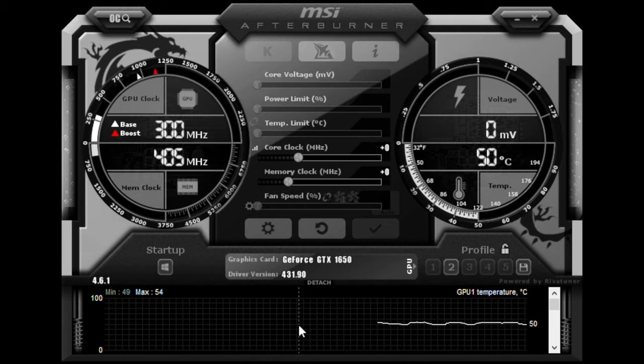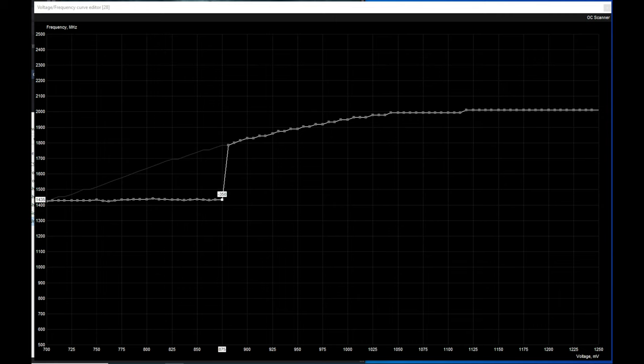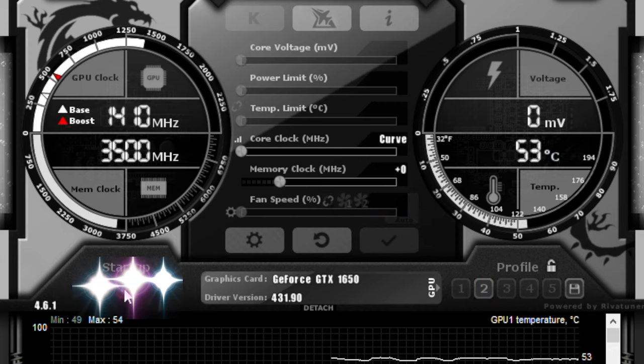After plugging in your laptop, download and install MSI Afterburner. In MSI Afterburner, hover your mouse over the hardware monitor and press CTRL+F. Then drag each dot to approximately 1400 MHz. Press the X button, hit apply, and hit apply at startup. That's it. Word of warning though: every laptop GPU is different, and 1400 MHz might not be the perfect frequency for you. You might need to play with different frequencies to eliminate thermal throttling but also not decrease performance.